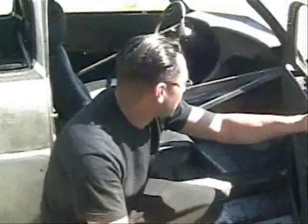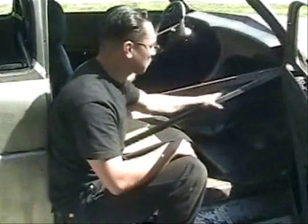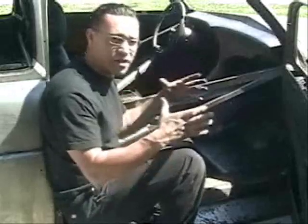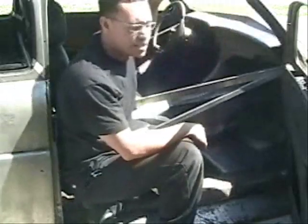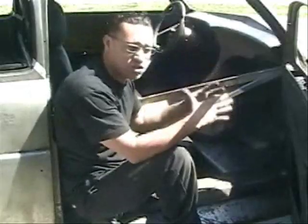It's not too far along in this project, but I want to stress the importance of bracing the inside of the vehicle. You can see here I have posts going at different angles to the floor so the body doesn't cave in. Once you cut the roof off, the body loses a lot of its integrity. The roof is a lot of the strength in this vehicle and kind of holds it together, holding it in shape.